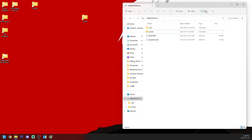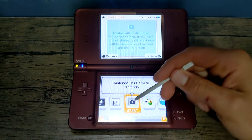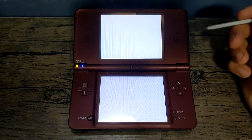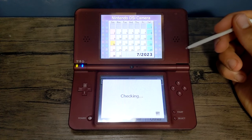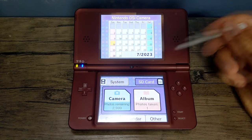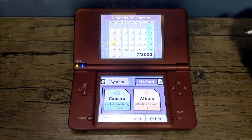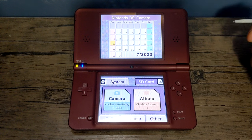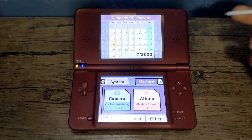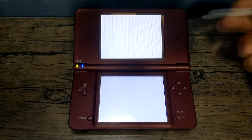Once you've done this, eject the SD card and head back to the DSi. We're going to head into the camera app again and select SD card, then go to album. If you receive a message saying your SD card is not inserted, you will need to use a different SD card. If you receive a message saying your SD card cannot be used, double check that you have it formatted as FAT32. But if everything is all good, click on the album button and you will see a magenta flash — that is what we want, and it will load the exploit.